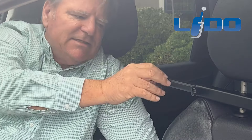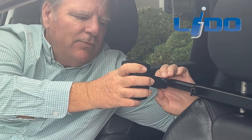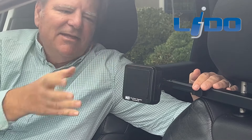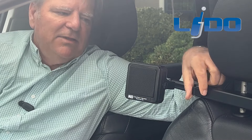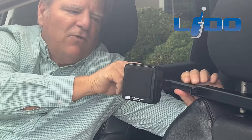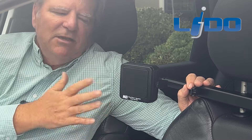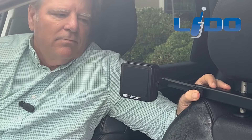Now we're going to attach our MFJ speaker to the headrest mount. Take the retaining ring and slide it over the 17mm ball. The Lido mount has a socket that we've attached to the MFJ speaker. We just snap it onto the ball and tighten the tightening ring until it's good and snug. Now our speaker's mounted. Since the speaker sits on a ball, we can adjust it 360 degrees to get the perfect position and direction for our audio. We can also adjust the length of the headrest arm — move it closer to or farther from your ear. This mounting solution works great whether you have a ham radio speaker, a CB speaker, or a GMRS speaker — no holes required in your vehicle.